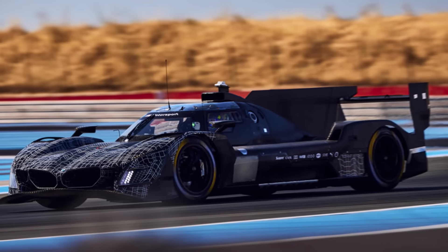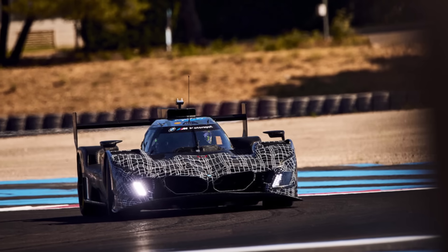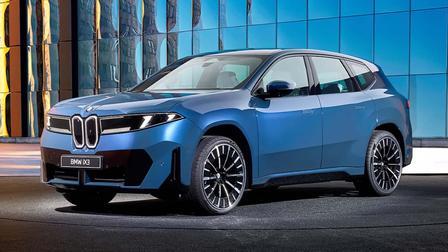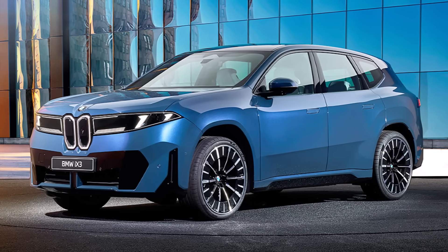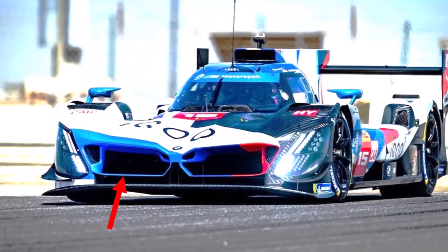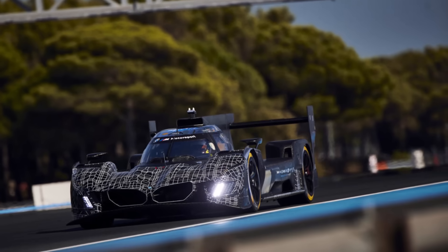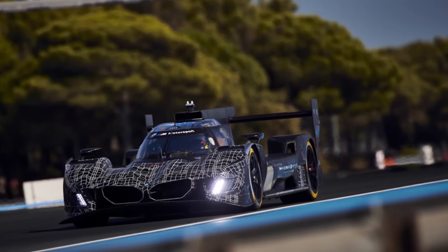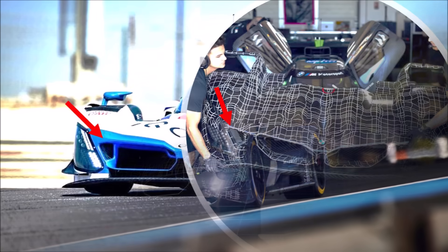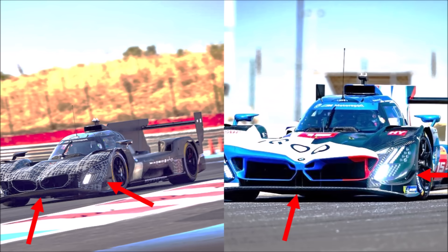So which changes can we spot? First of all, the kidneys are smaller, but that might just be a design topic with BMW moving to smaller kidneys also on their road cars. The previous large kidneys provided an additional horizontal element which they could use to direct air. The new kidney has a vertical part as well. BMW claims to have new headlights, but at the test they look like the old ones. The brake cooling ducts stayed in the same place but have a slightly different shape. The big aerodynamic changes we can see at the front are the missing canards and the much higher front splitter.